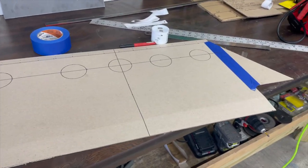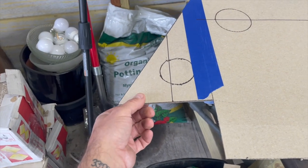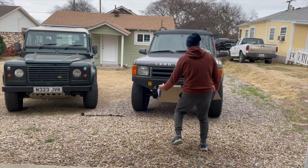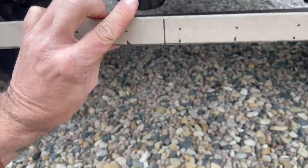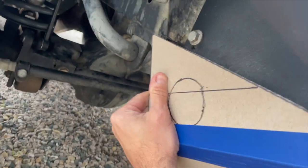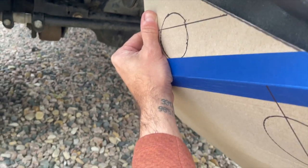Yesterday I created a cardboard template and it's going to be a hybrid solution. These steel wings are going to mount to the actual bumper itself. The front mount is going to bolt to the front of the bumper and thread into that front plate. On the sides, the wings come in and stick back a little bit further to give more protection. Let's get to cutting the steel and hopefully I can go to my friend's house and do the actual welding today.